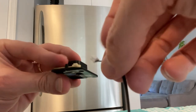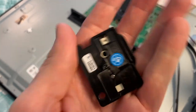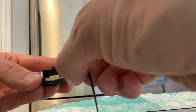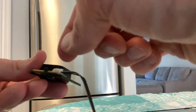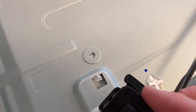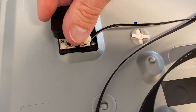Again, do not separate the wiring from the white connection point. It should come off fairly easily, and you should have your part number on the back side — here is a better view of it. The part number should be on the back side as shown here. Go grab your replacement part, re-secure the connection point, and slide it into place. Realign your connection point and push in until it clicks as shown here, and verify that the upper plastic tab is flush. From here, you've got a little slot that is going to slide right into that aluminum tab, and then a hole that shifts over the little tab right there.